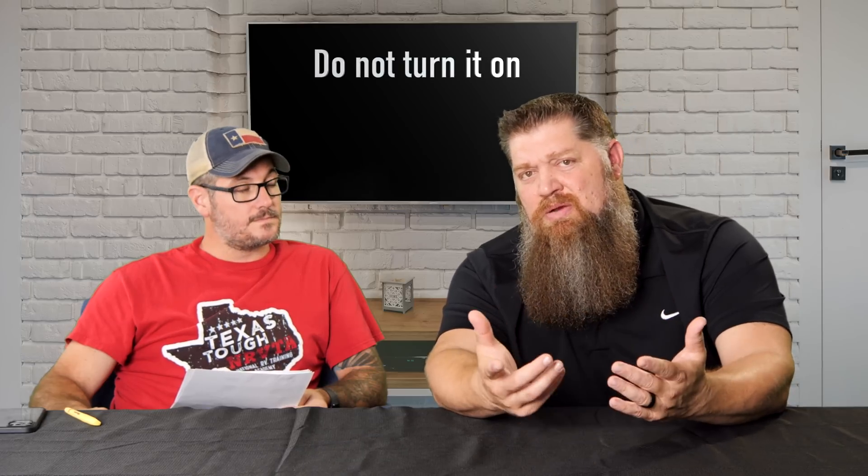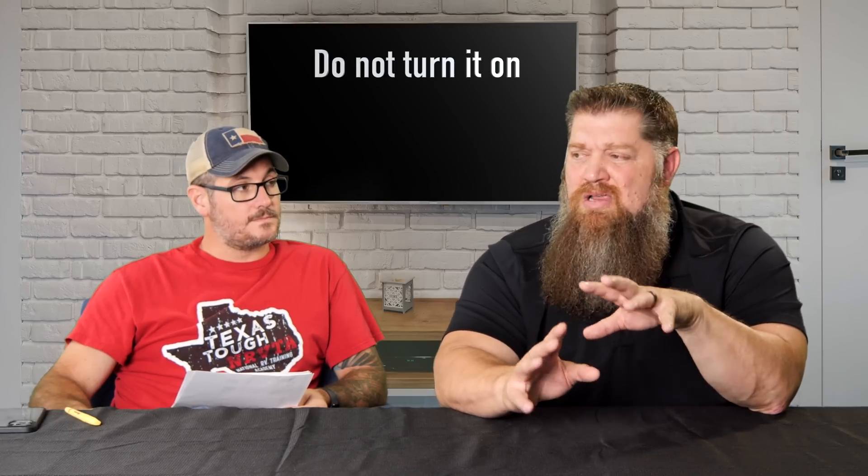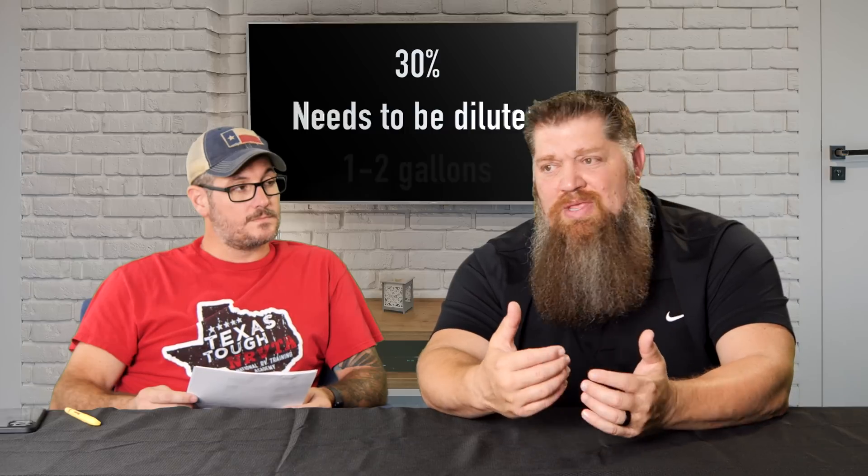The last question — do you turn it on? No, don't turn it on. I know that's what we were taught with coffee makers, but that was the only way to get it through that system. Just let time be your friend. If you go to your local Tractor Supply or a farming store, you can get 30% vinegar. If you get 30%, you need to dilute it — get one or two gallons and fill the rest with water until it comes out the P&T valve. Let it sit overnight. Then open it up, let it drain. You'll get a white milky substance. Fill it back up with water and let it drain — do that several times until the water comes out completely clear. That's how you clean your water tank.